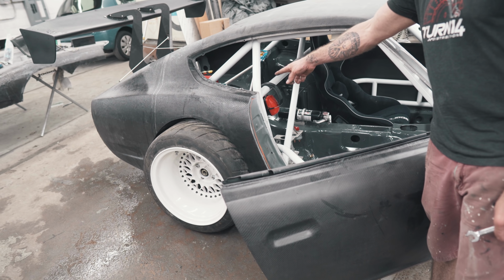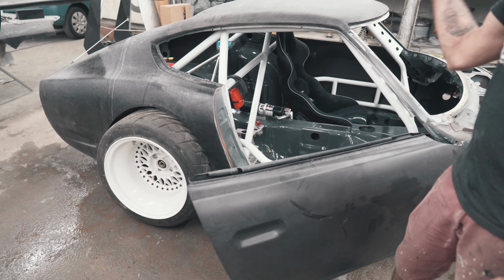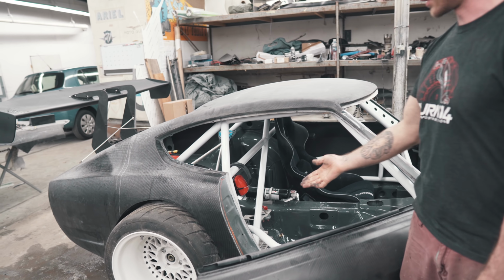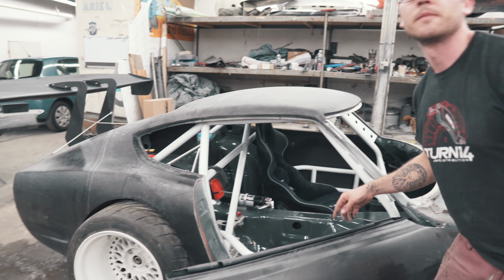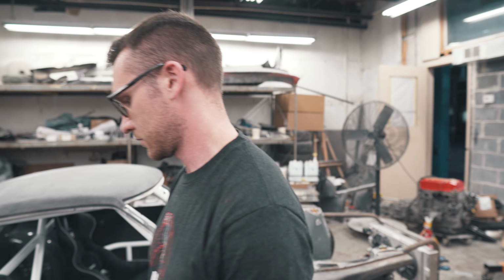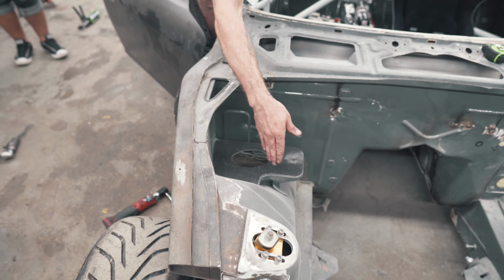How are you gonna tape off the jambs? Oh, I'll just tape the carbon, back tape the jamb, spray that black, untape the carbon, matte clear everything together. You want to matte clear the door jambs black? Yeah, because that'll be cleared with this as well. Did you decide what color you're gonna paint the engine bay? No. So you're not doing black. No. Are you gonna matte clear or regular clear? Regular clear. From like this line in will all be tossed.